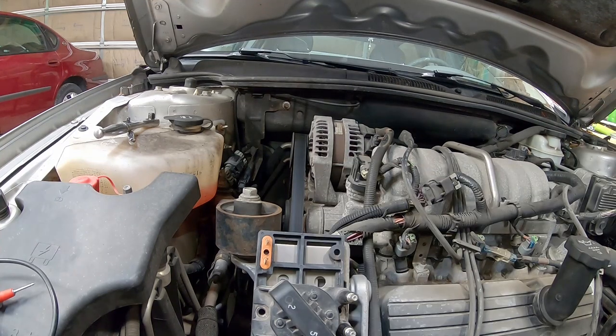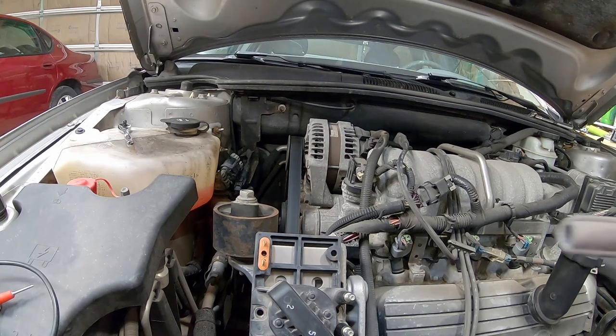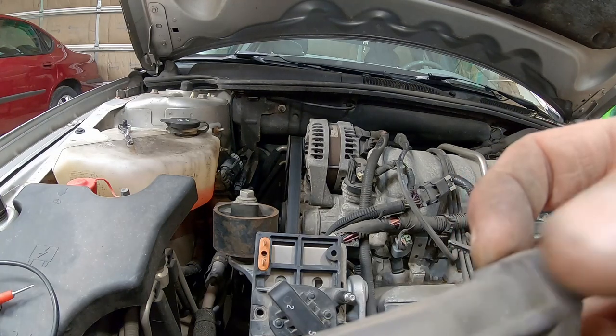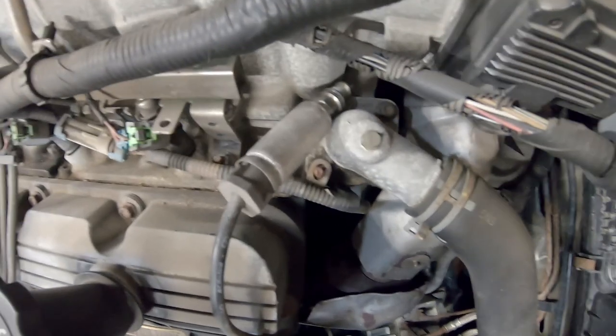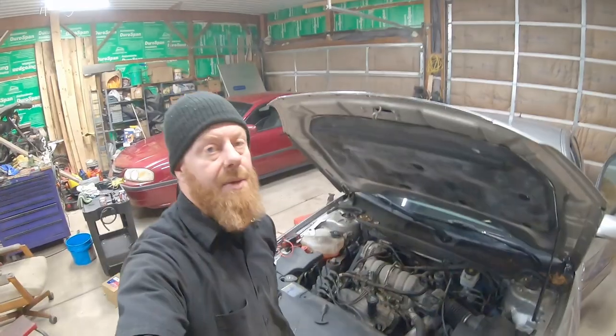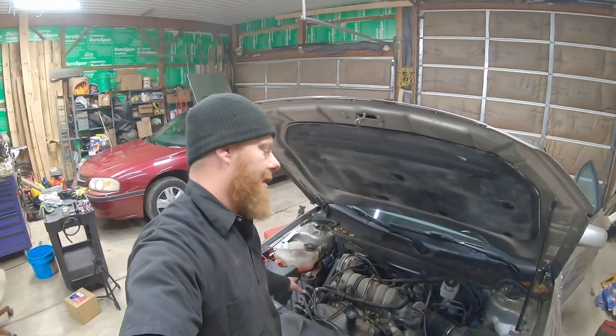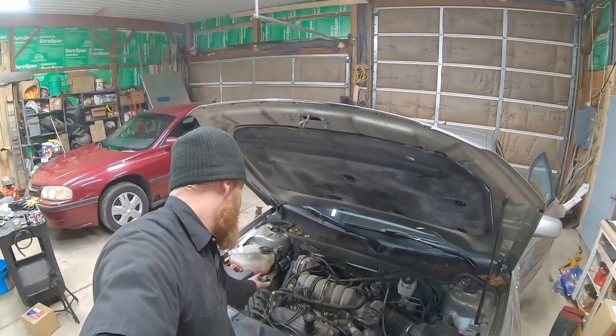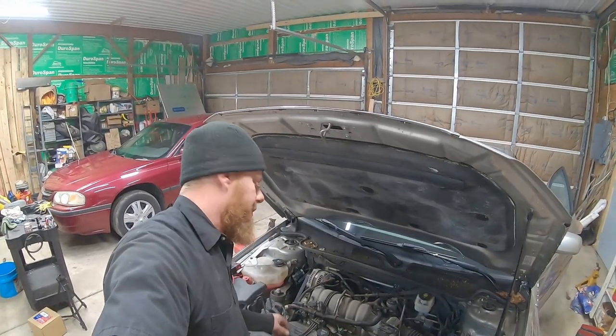So I'm going to put this plug back in and hook the plug wires back up. Should also mention this is our number 3 plug wire boot — I don't see any signs of carbon tracking like it's arcing. We're going to have Alex fire it up and see if there's spark on that other coil. Yeah, she's got spark. So now I'm 100% sure the ignition module has failed. It is not firing that upper coil. No matter what coil we put on there, we get no spark from it.